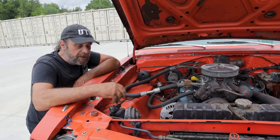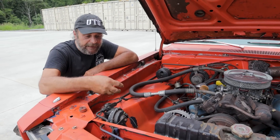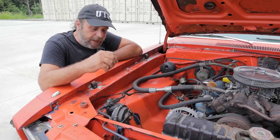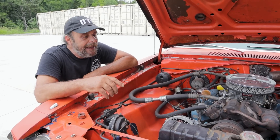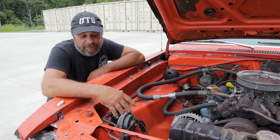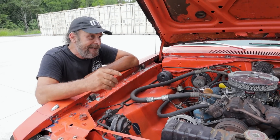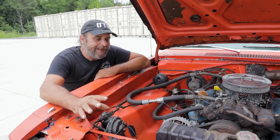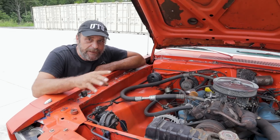Because as soon as it's opened, the moisture from the air gets in there, saturates the element inside, and it won't function the way it's supposed to. Yes, in a pinch I've often reused these things just to get it running, but you're not supposed to. Anytime you open or service the system, replace this bottle.